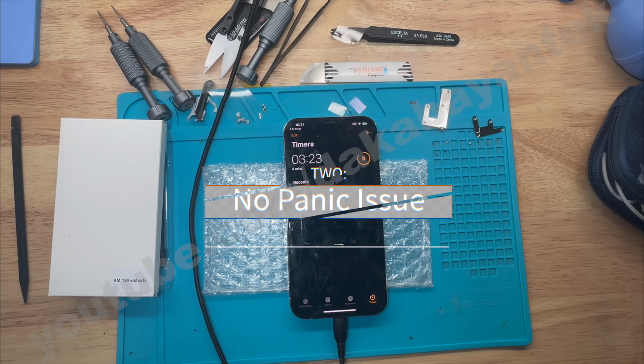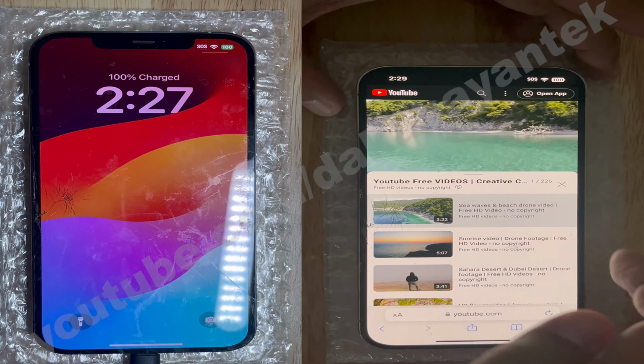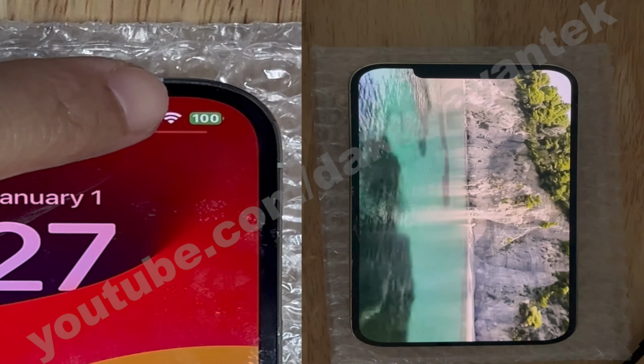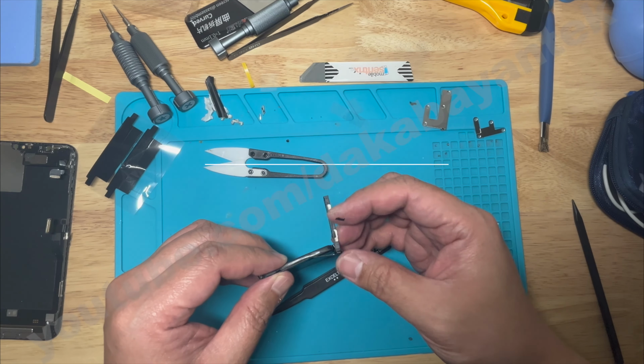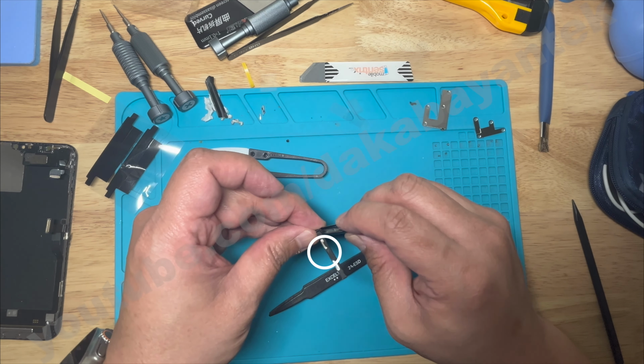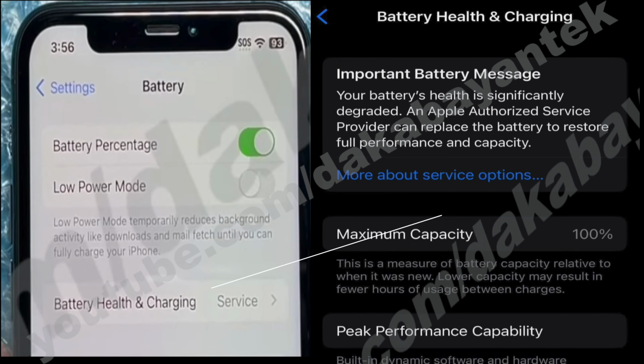Next issue or concern is if it restarts or will have panic issues. It did not restart and charging works with no issue. I fully charged it and played long videos until fully drained. The battery has no issues or problems. Next would be micro-tearing that might occur while flexing the cable around the new battery. And the last issue or concern: if the original battery is below 80% and has the service prompt status, it will reset the percentage but will still show the prompt, as what others are experiencing, even on the welding process. I still have to test it on another phone and provide another video for it. I do have the solution for this issue on the welding method, video link in the description below.